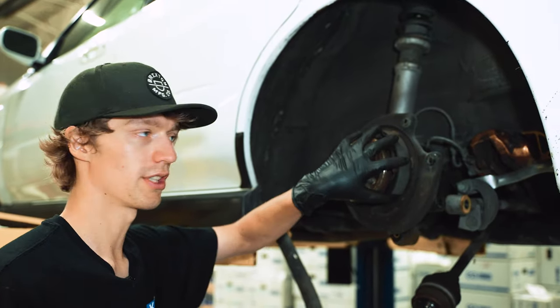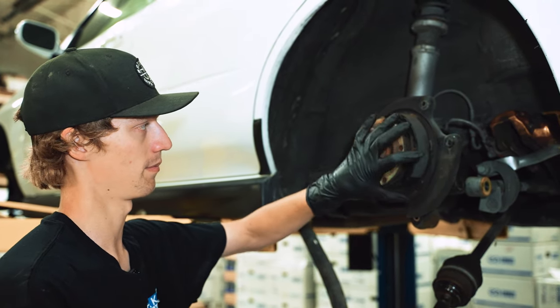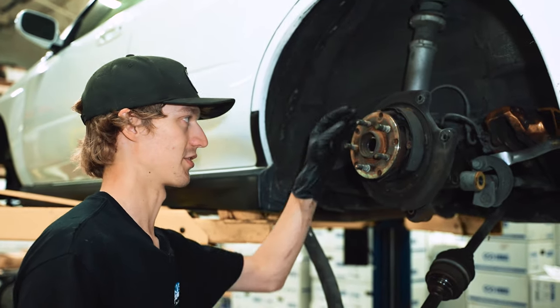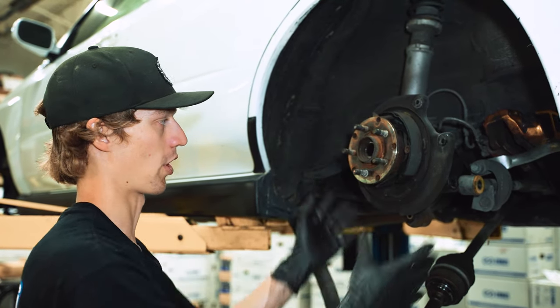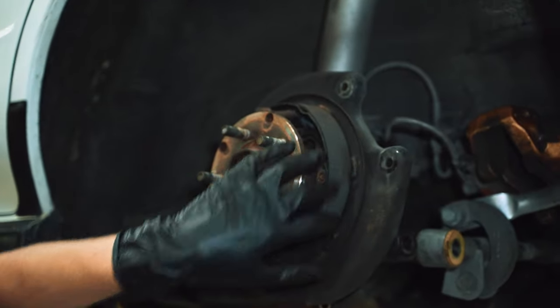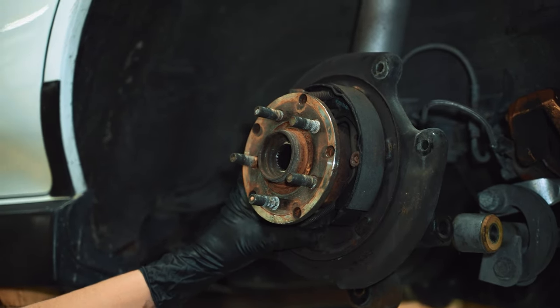So like I mentioned in the beginning of the video about the parking brake, this had some mismatched arrangement of shoes and hardware that are not correct for these STI knuckles. So that's why it's partially disassembled. Basically, we're gonna pull all that off and replace it with the correct stuff. So that's just going to involve removing the rest of it on this side, as well as the cable. That's pretty much all that's still holding the knuckle in the car.